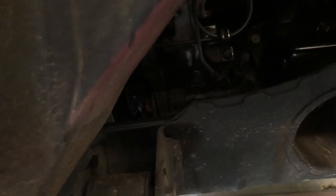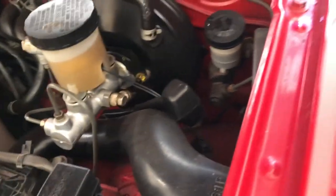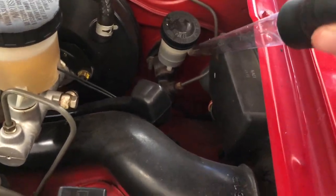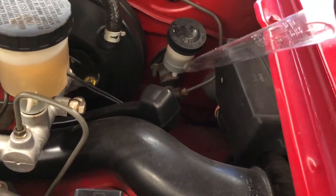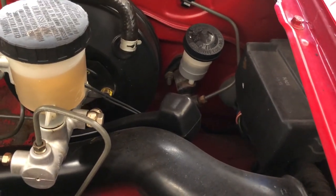All right, so here we are. The slave is right back in there. I believe it's two 12s and then it comes off. So it's right there. I've seen a lot of people say that you need to empty this out first — the master cylinder for the clutch. So we're going to use this turkey baster here, empty some of that out, and then get on our way to removing the slave.